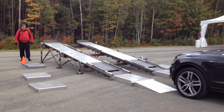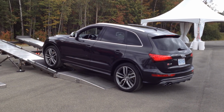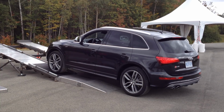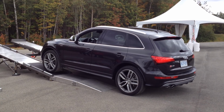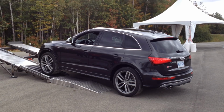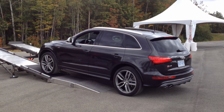Okay, Chris, go ahead. So we're going to cradle the front wheels. Okay, back off the brakes just a tad. Okay, so now we've created a little bit more resistance. We're sitting in the divot. Chris is going to give throttle, but unlike the lady who drove in the video, Chris is going to sustain the throttle, create momentum, get the clutch pack to bind.